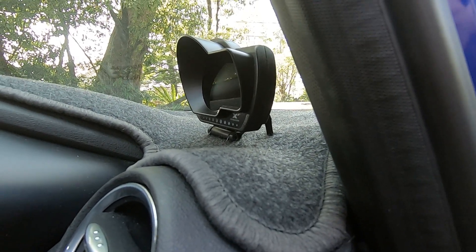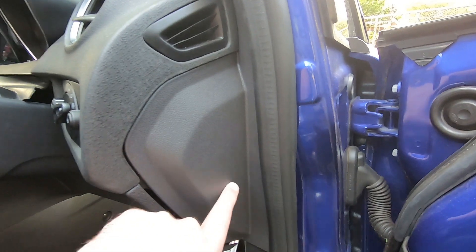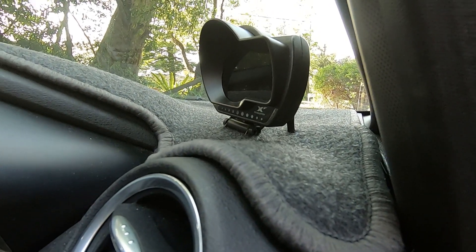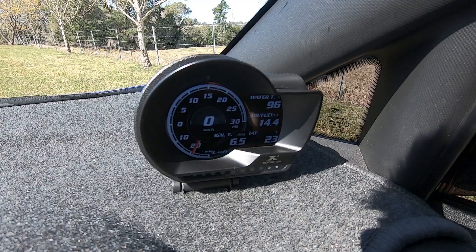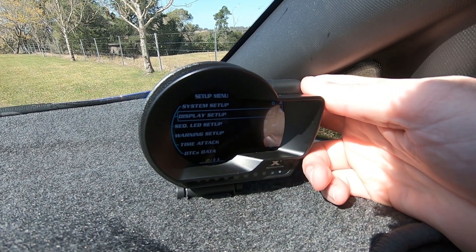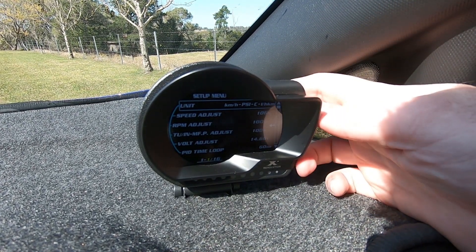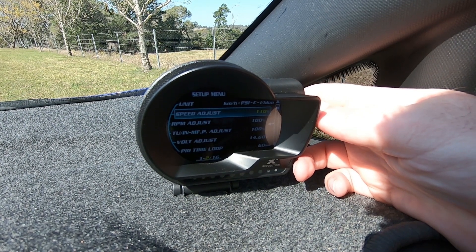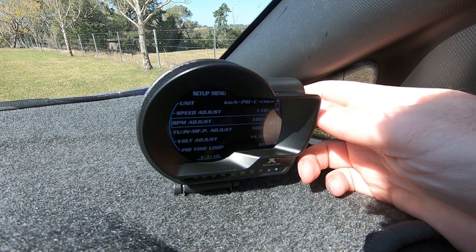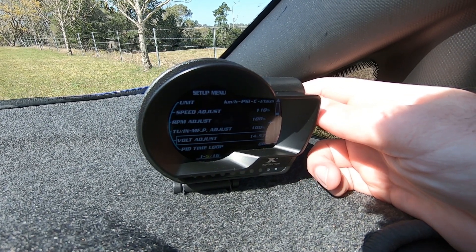Here's what it looks like installed. That's the only part of the cable you can see coming out of the back, and then it's underneath, runs in between that gap, comes down and is hidden behind here. So the only visible part of the cable comes straight out of the back and down into the dash mat — super clean install, really happy with that. Running through some features: you've got your system setup where you can change your units — kilometers, PSI, all that. Speed adjust, because I've noticed my speedo is just a little bit out so you can actually adjust it. RPM adjust as well — if your tacho is reading 2000 and this is saying 1800, you can adjust that too.